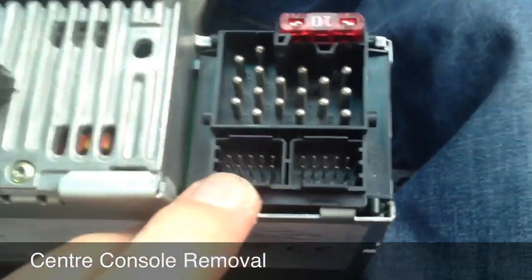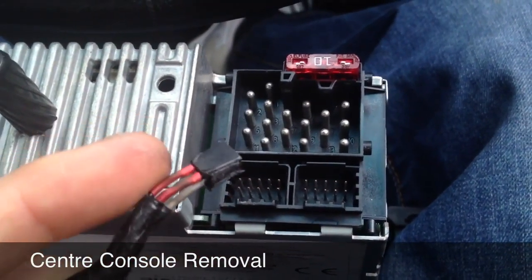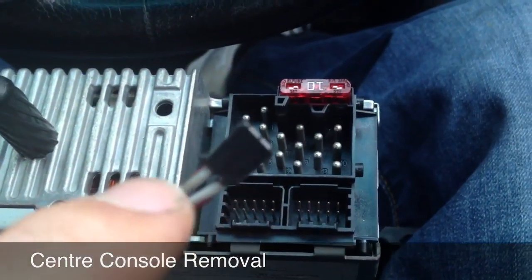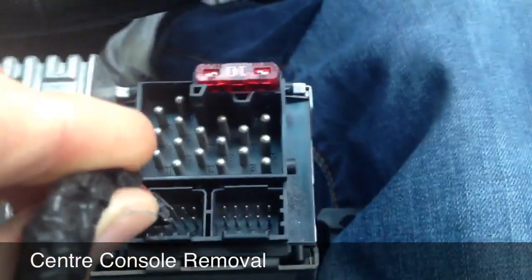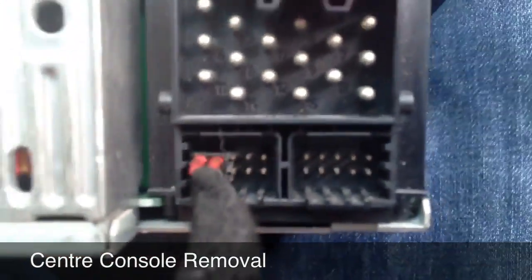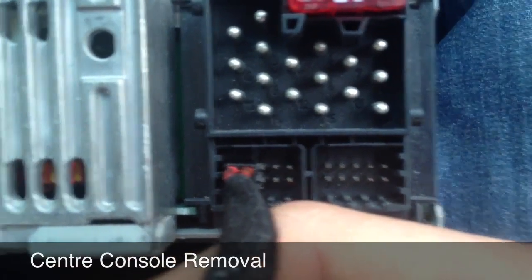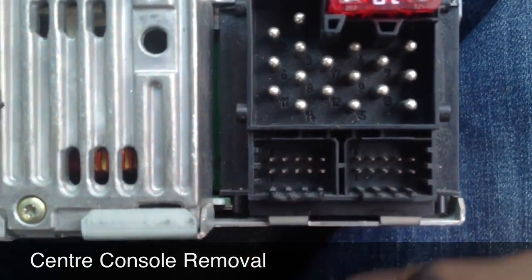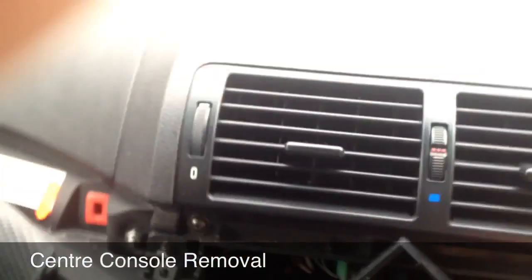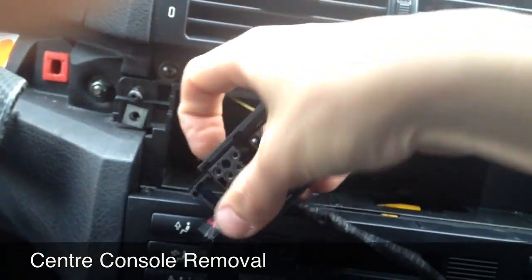Now, your CD changer would normally run off the left 4 pins. This little cable I've given you has a red, which is your positive, and a grey or some other random colour, but I'll always have the red at the top, so like so, that just slots straight on there. The top are always red and they go to the far left, and the pins next to them will be occupied.